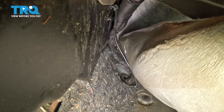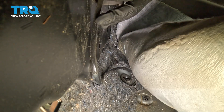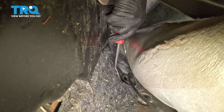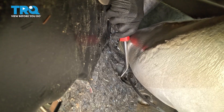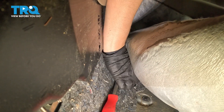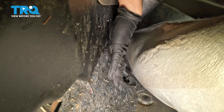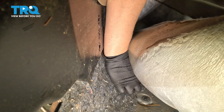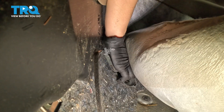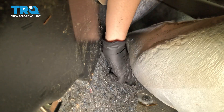Now I'm sitting in the passenger seat and I have my carpet pulled back. I'm going to pull out my connector — just remember where you got it. And then we're going to take it out of the floor over here. To do that, you're going to push back on the rubber thing and just push down, and it should poke through. Once you get the grommet out, you can push it through all the way. Just feed that wire down — I would do it from up top, feeding it through, just so you don't get snagged on anything. It's a pretty long wire.